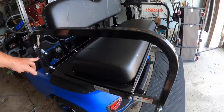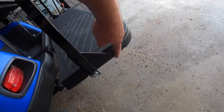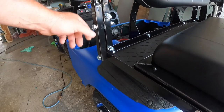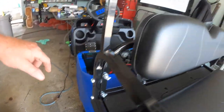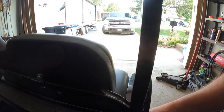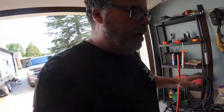It's hot out today — I wasn't going to do this today but I want to get a video out for you on this because you need to know these things. Next thing you want to do is bolt this piece on here. Now it comes with little angle doodads — some guys are putting them up here somewhere, but they belong down here. This is for the step, so this piece goes down here with a bolt through it. You put a bolt through here loosely and put a little spacer in there along with this piece. You put this piece on the inside — it goes on the inside and around the back. It's for the back of the seat and these brackets are for the seat itself. Once you're done that, you put these on which is for the roof — two bolts. Get it all on, remember put everything on so it's loose, don't tighten anything except for those two brackets like we talked about. Everything else leave totally loose.